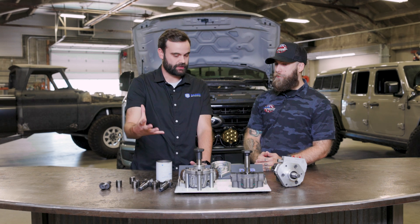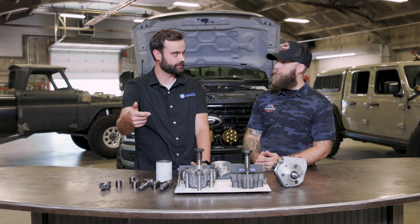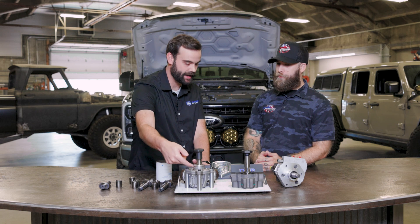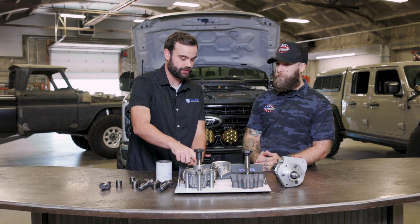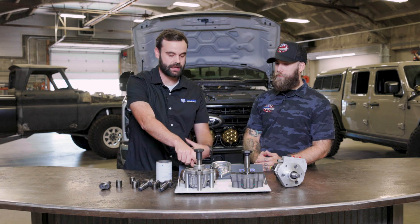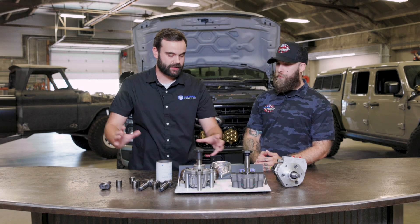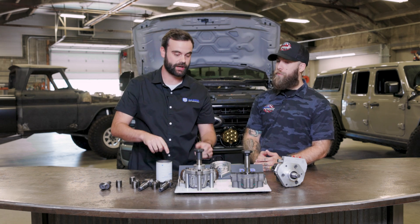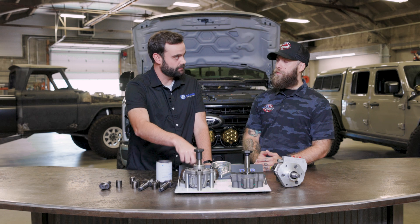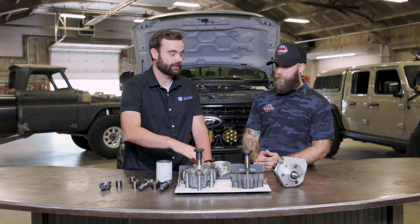The way the CP4 is fed is really the issue as to why that happens. It comes straight from your fuel tank — the low pressure side — to the bottom end of the pump. From the bottom end it goes straight to your IMV, your FCA, your metering unit — depending on manufacturer, what you want to call it. This inlet metering valve helps regulate the fuel going to your high pressure side — your injectors, your rails. So when the pump fails from the bottom end making metal debris, there's nothing stopping it from hitting your metering unit.